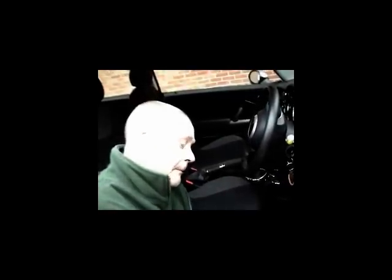That's a general run-through of the Launch X431. This piece of kit will do some programming and matching — like matching a throttle body to an accelerator pedal or coding keys. As far as I know, it's one of the best value-for-money tools available. It's almost half the price of a Snap-on Solus, and it will do as much if not more. We update the information roughly every month to keep up with later vehicles as information is released by manufacturers.